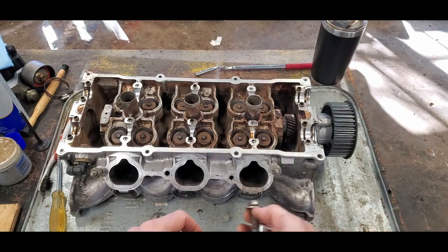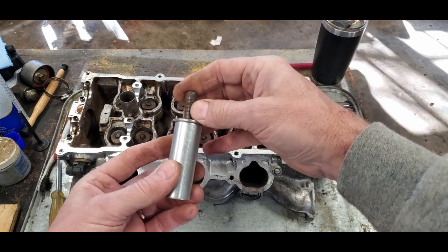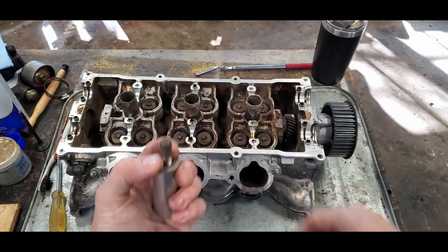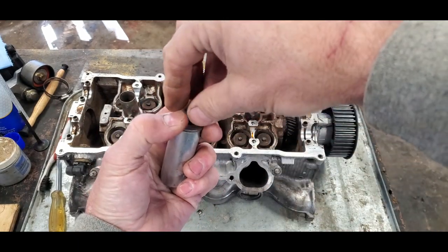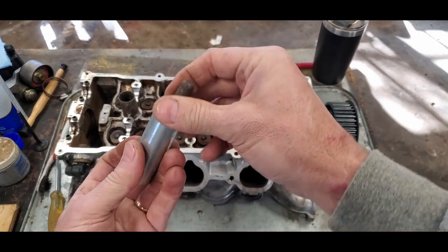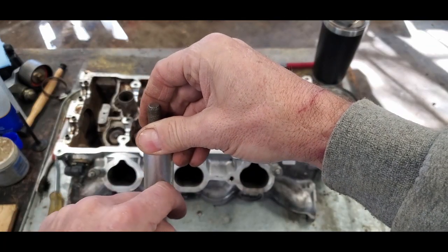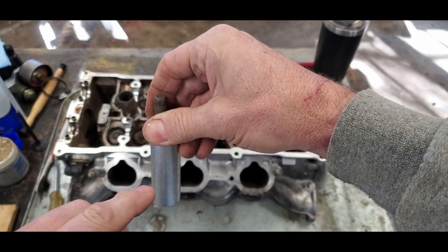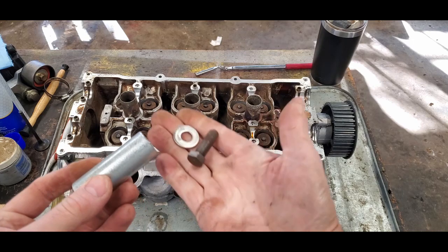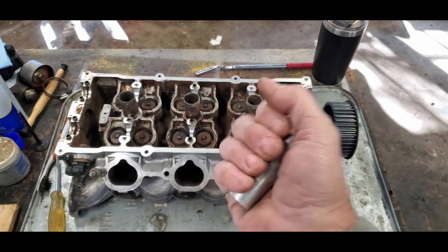Well, I had one of these a while back and don't know what I ever did with it, but I had welded a bolt to the head here, just so I have someplace to chuck this up into my drill press. That way, my drill press was actually a press that I could then just push down, reach in through this little slot to get my wedges, pull them out with a magnet and put them back in with a pair of needle nose pliers. So let's go get these three little pieces out of the junk pile and fab them up into a tool.